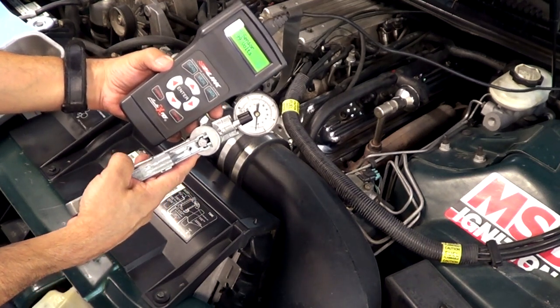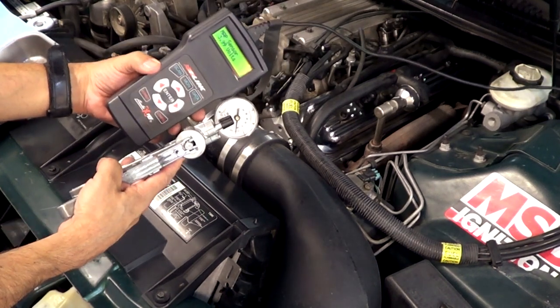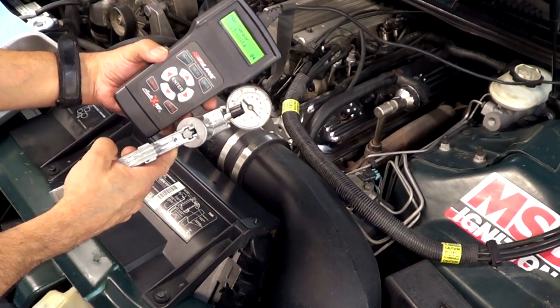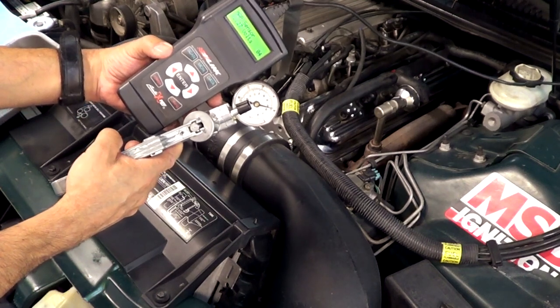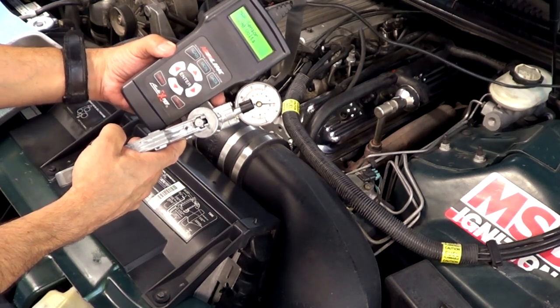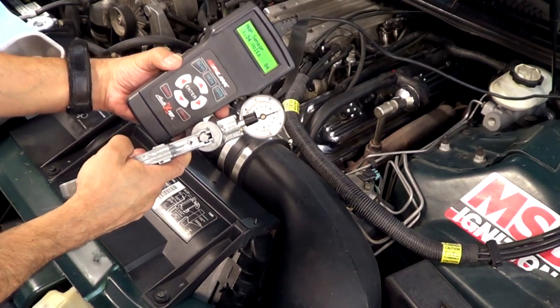So that's how you can test your sensor. If you think that you have a malfunctioning sensor, you can connect your scanner and apply vacuum slowly. You should see the signal change gradually — it shouldn't change suddenly, or have spikes of signal drastically going up or down. It should be a steady increase or decrease as you change the vacuum signal.